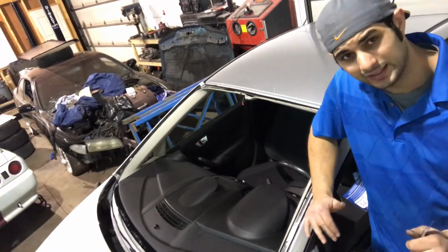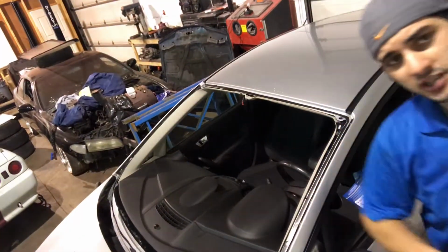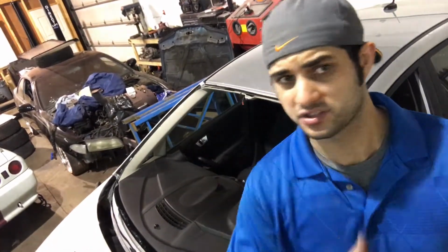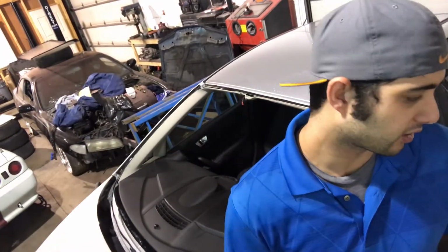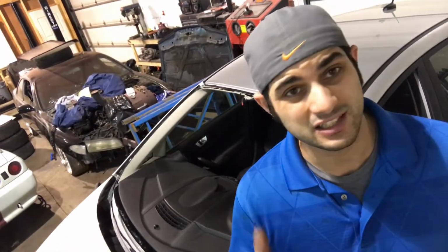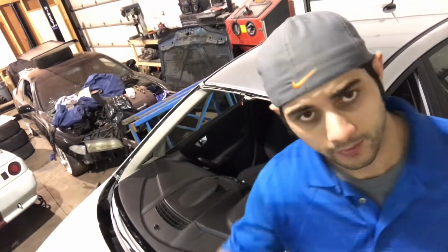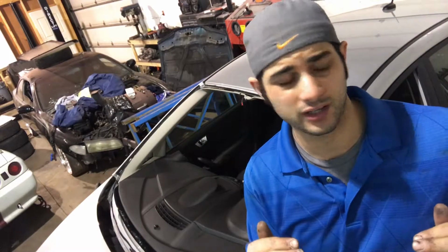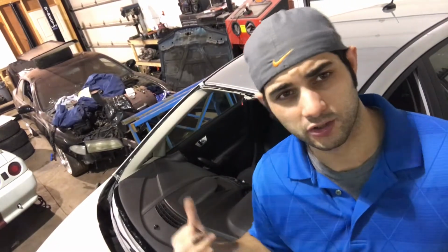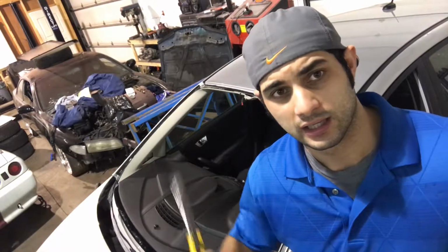We've activated, we cleaned the glass, we put suction cups on, we've activated the glass, I put the GPS sensor back on the glass. The mirror has to stay off until it's back in the car, and then we put it on. So the glass is ready to go in. Then I put activator on the glass because now I'm at the stage where I'm very close to putting the urethane on, so it was the right time to do that.